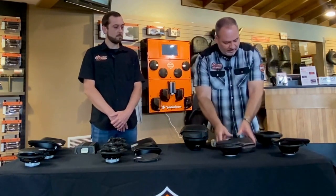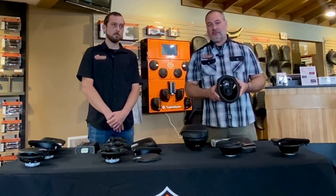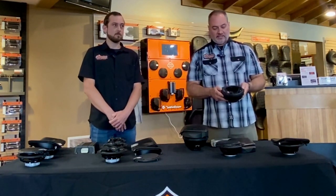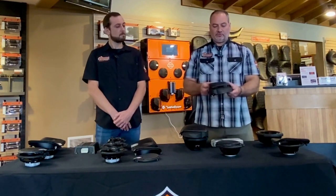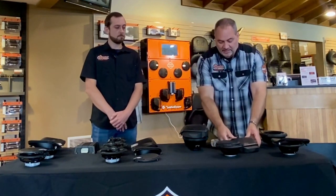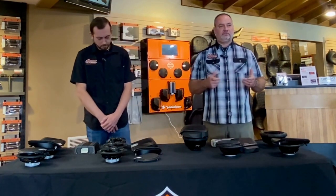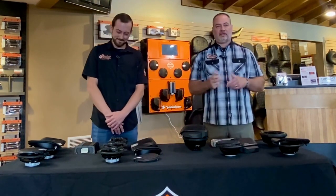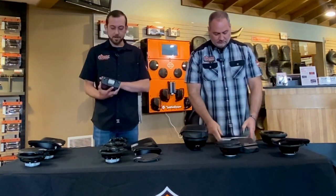The saddlebag speaker that differentiates Rockford Fosgate from Harley-Davidson is that this is a six-by-nine speaker. With Harley you have to buy the molded saddlebag and color-matched lids, but with Rockford Fosgate you can use your existing saddlebag lids — you cut the lid, it has a screen that goes over the top with a seal, a frame underneath that bolts together to seal the saddlebag, and the speaker bolts up underneath. Both systems seal up the saddlebag nicely, but there is a difference in how you mount them and use them, so again there are some differentiations in the systems.